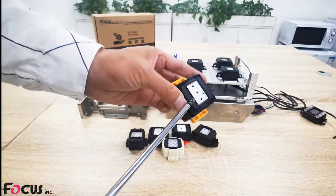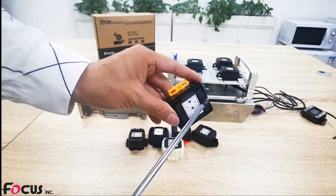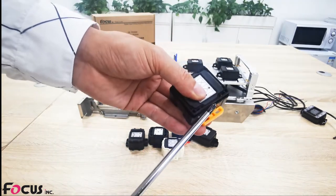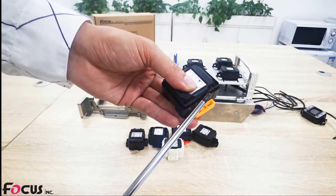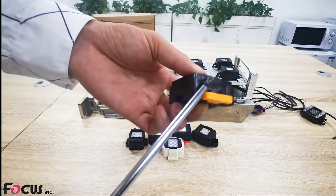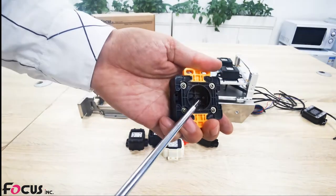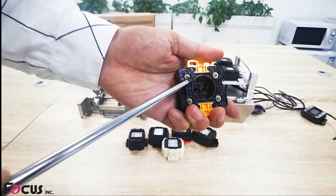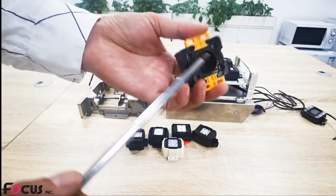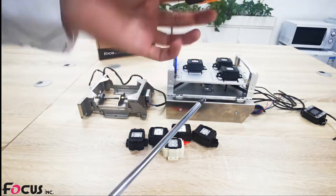We check this next one. It is commonly used by other brands and many people on the market use this kind of cap. When we push down the cap, the waste ink easily spreads to the edge of the connections. Once the ink leaks to the edge and flows to the bottom, it can damage electronic or mechanical systems above or below the cap. This cap station easily leaks ink and can damage parts, so we throw it away too.